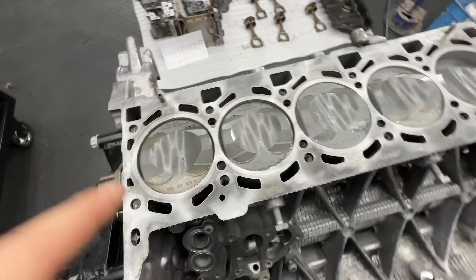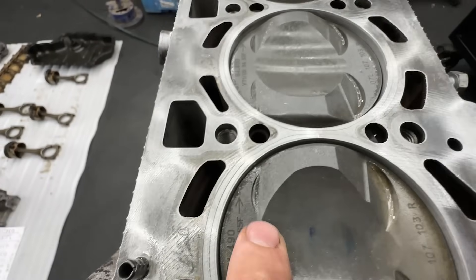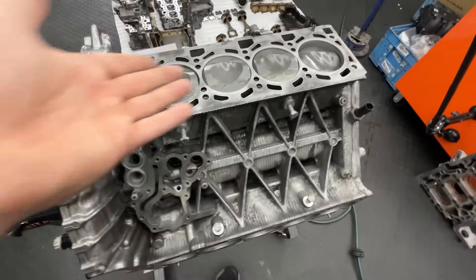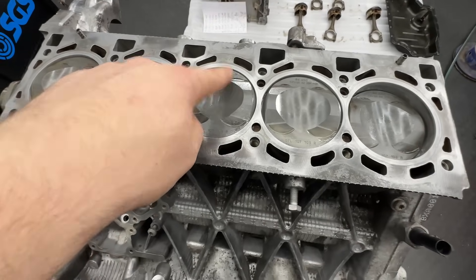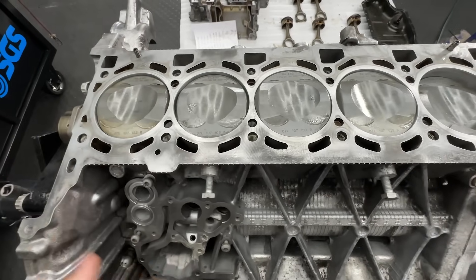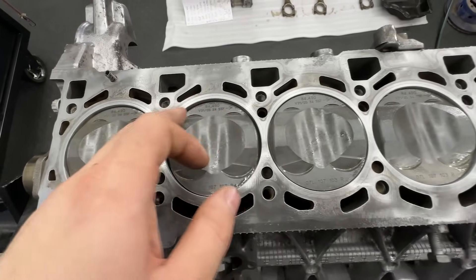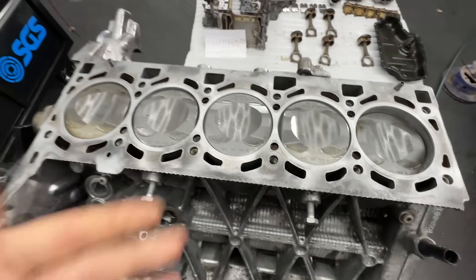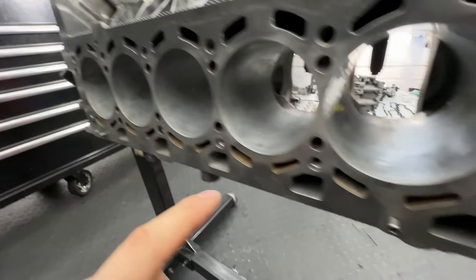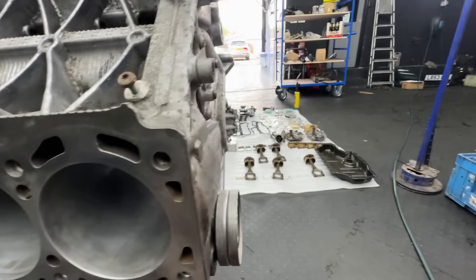We have the first five in - cylinders 6 to 10, all sorted. I'm not sure if you can see the arrows, but all of them are aiming towards the front. If you have a replacement and it's aiming to the side, but you have these cuts for the inlet valves, it should be fine. They're all the same, it's just literally a guidance so you don't mess up, otherwise you end up with a bent valve. So we will continue with cylinders 1 to 5 - just clean up the bore a bit, put a bit of oil in them, and continue putting the rest in.